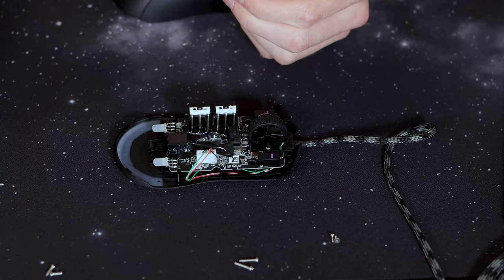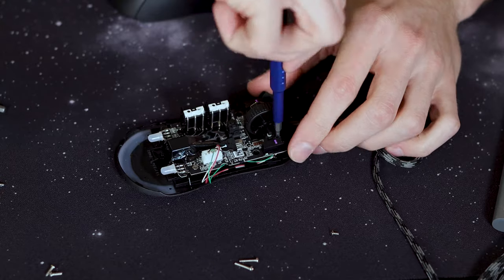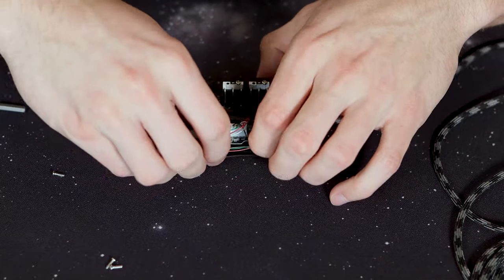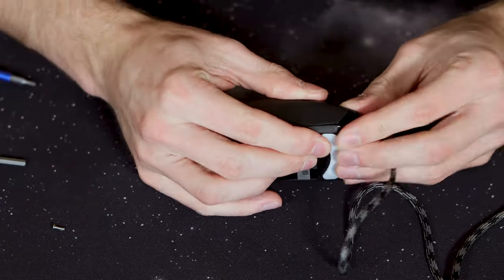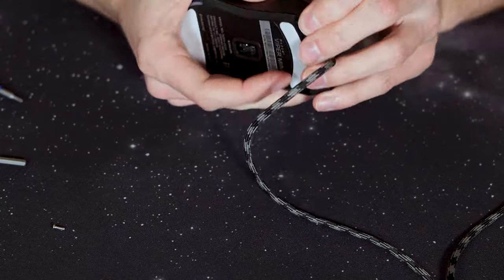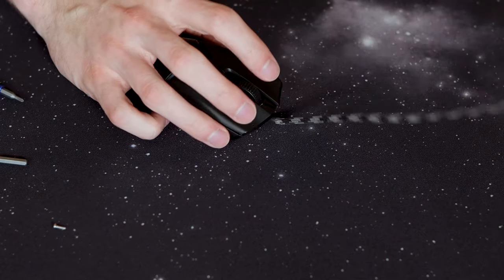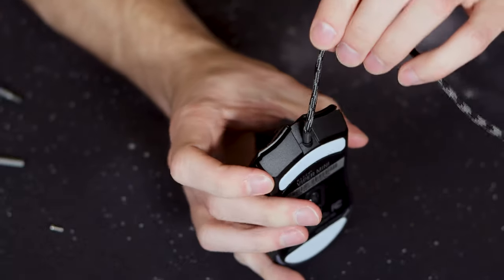Once you have it all back in, make sure your wires are plugged in well and the connection is good. Make sure wires are routed safely, then put your PCB back on, sliding it down those posts and putting all your screws back in the right spots. Then put that shell back on — those clips will just automatically click back in. Make sure it's all clicked around because if it's not, your clicks won't work right. Make sure all the seams are flush, put your screws back in the bottom, and push your sticker back down. The 3D printed stress relief makes the front look really professional, almost like it came from the factory.